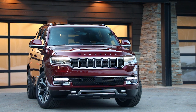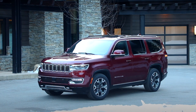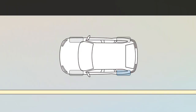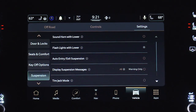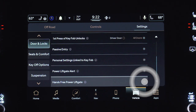There should be no one in the vehicle. Block the front and rear of the wheel diagonally opposite the jacking position. For example, if the left rear tire is damaged, block the right front tire. If your vehicle is equipped with air suspension, automatic leveling should be disabled in the Uconnect system by selecting Tire Jack mode. You should also disable the hands-free liftgate before proceeding.